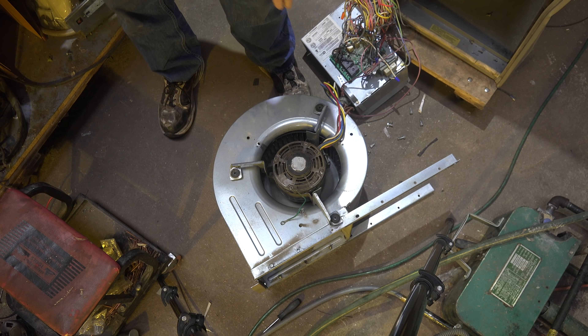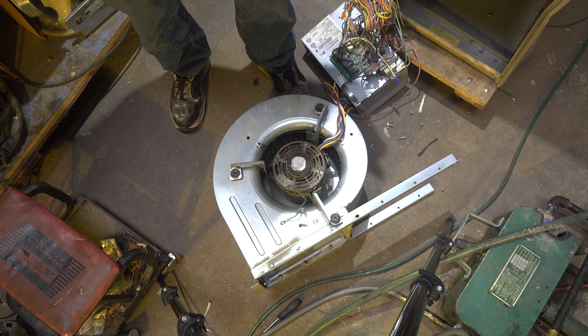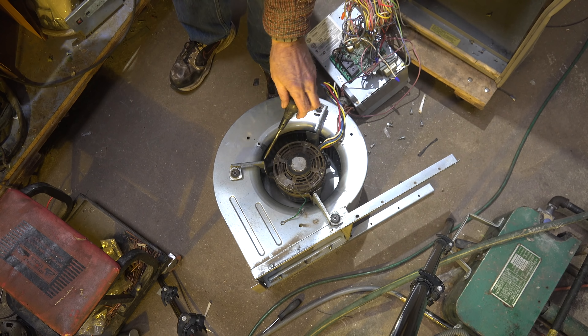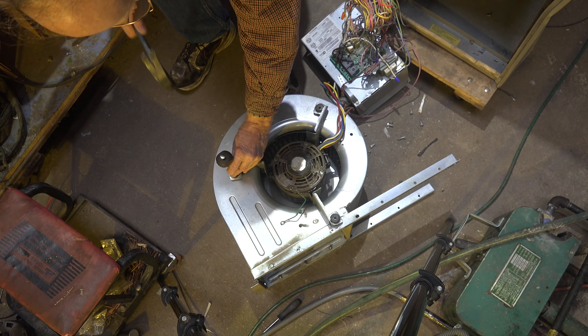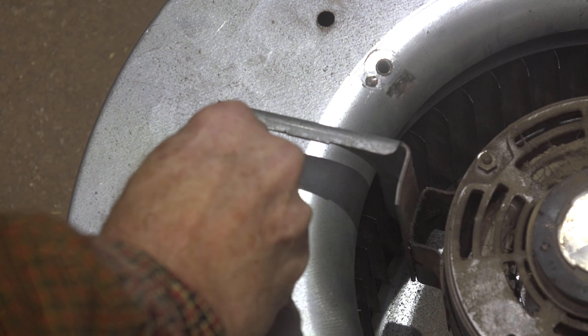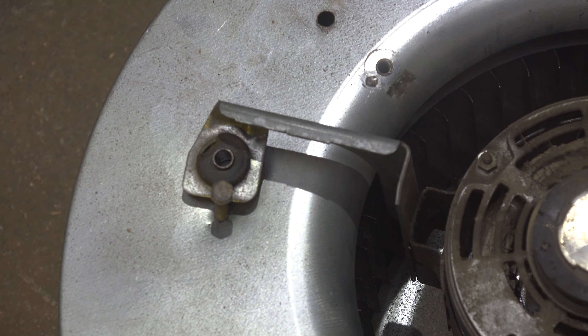Here's what I like to do when mounting with these brackets — you can buy them aftermarket and they come with sheet metal screws. Instead of drilling the holes, I use a scratch awl to punch the holes. If you notice, the hole is dimpled down, and when I put the sheet metal screw in it's going to grab onto more than just the flat sheet metal because the metal is bent in. I don't like drilling those — it's not as strong and it can shake loose. But if you dimple it down with the scratch awl it fits pretty well. You just have to make sure you get it lined up properly.